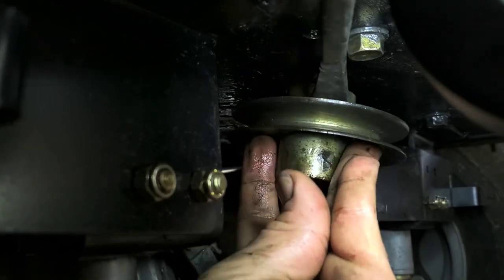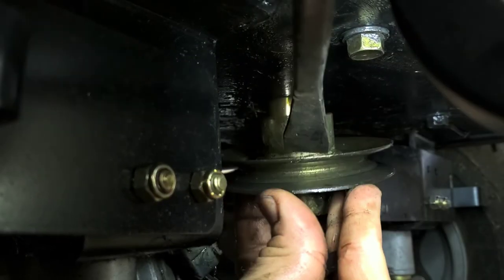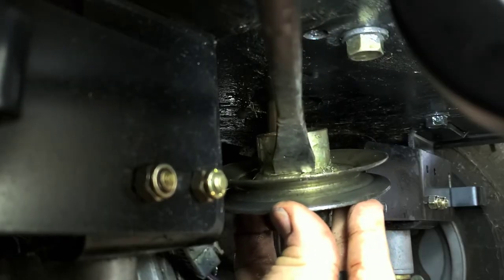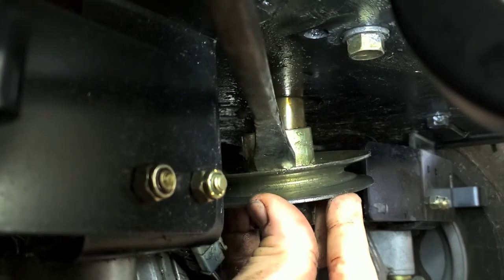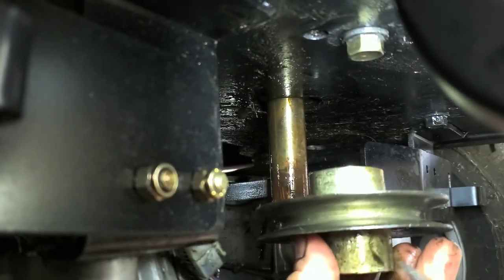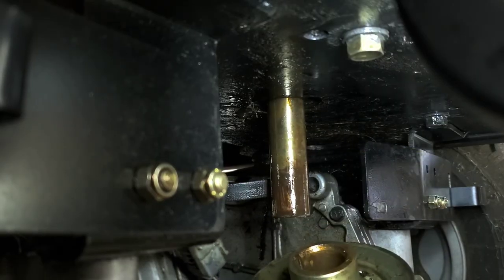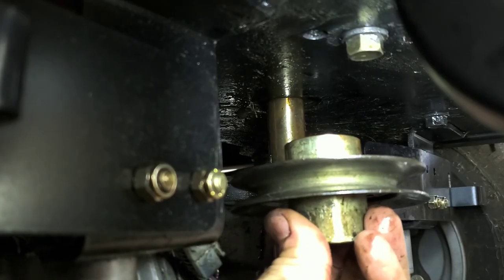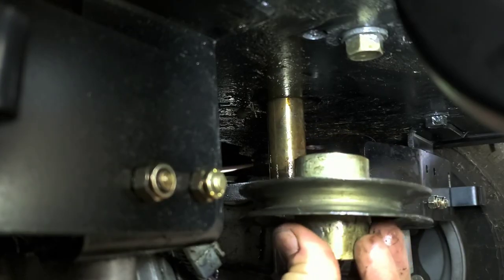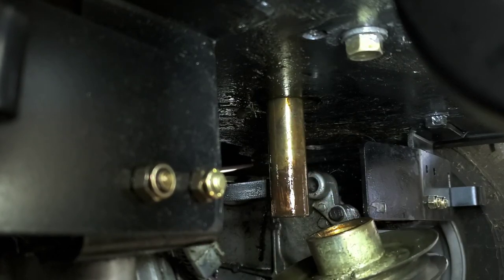against the frame. So, and you don't want to pry extremely hard to where you start getting back over here where the metal's weak on the outside, but on the inside here, the metal is pretty strong. So as you're hitting this with the vibration here on the side, if it's real tough, you'll be hitting it there and you'll be prying up here at the same time, and that'll move everything down. Just gives it a little bit of downward pressure to start it moving. Once it starts moving, it'll come off.